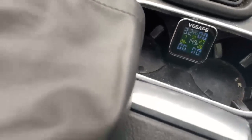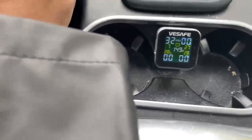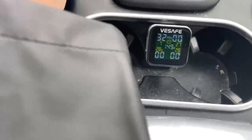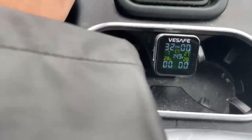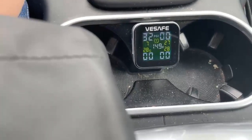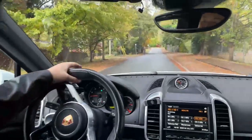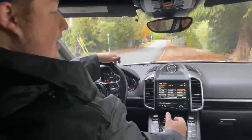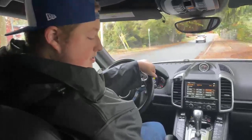As you start driving, you're going to see different warnings — either your tire pressure is too high or too low. Say you filled up your tire in the winter with nice cold air, and then it's now summer or you're on a road trip somewhere really hot like Arizona. Now your tire pressure is above what it's supposed to be. If it's too high, you're not going to get enough tire contact on the road because it's going to bellow out. It's also going to wear out your tires improperly.